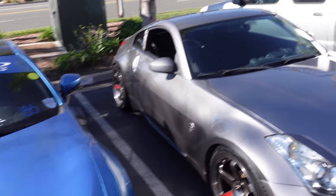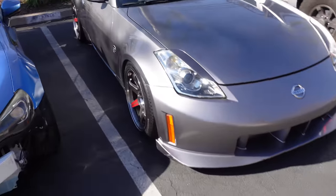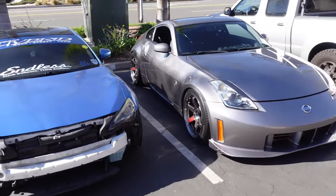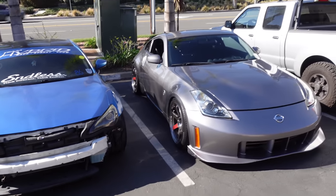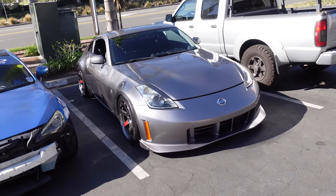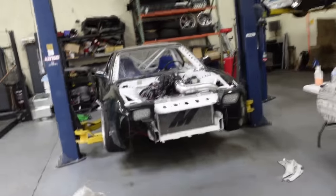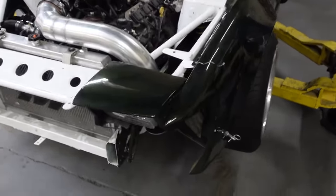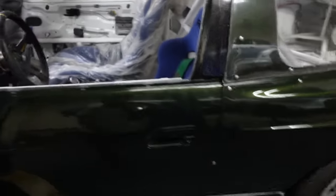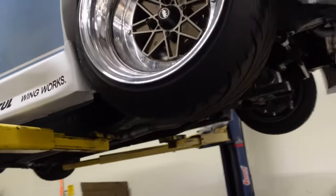With the SPL arms we'll get the rear back to like negative one or around zero so the tires will last longer and the car will be a lot easier to drive sideways. For the front, I'm gonna do arms to get it to about negative three for now, and we'll do an angle kit later. Some people say just go angle kit from the start but you can drift on stock angle — car is still driftable. I'm just trying to get everything I need. That's 13 boys — it's pretty sick, it's clean.